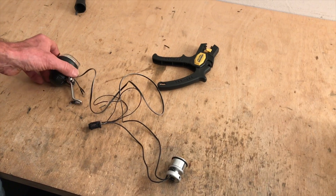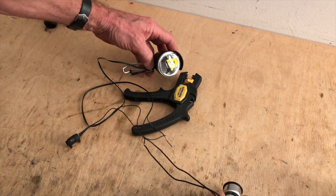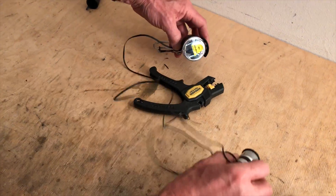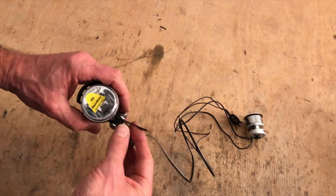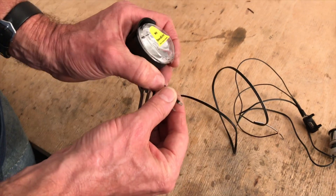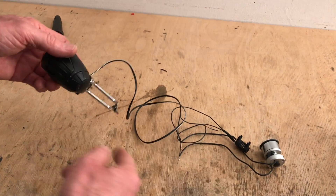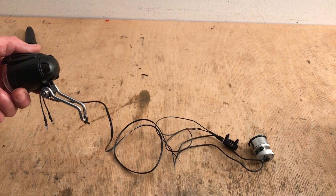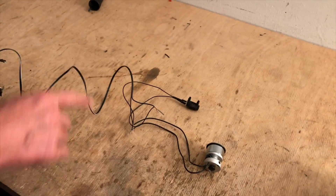Finally, the function test — this time not on the bike itself but on the tabletop. We roll the dynamo briefly over the tabletop here. Now an explanation for the connection of the taillight. Usually you would find the outputs for the taillight on the LED headlights — that's the normal way to connect them. The dynamo goes to the lamp, and from the lamp it goes back to the taillight. In between is, in our case, the Velogical dynamo and the PTC resistor.